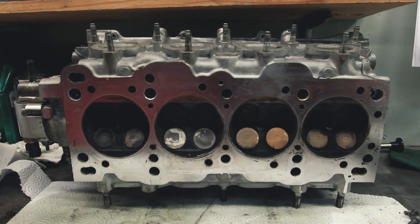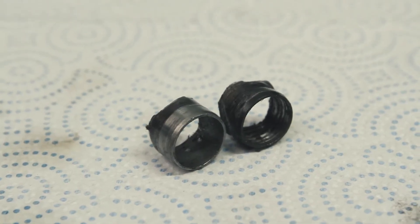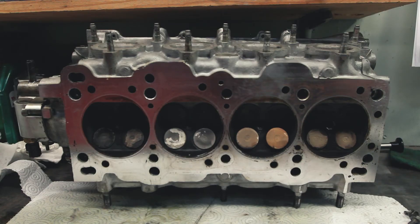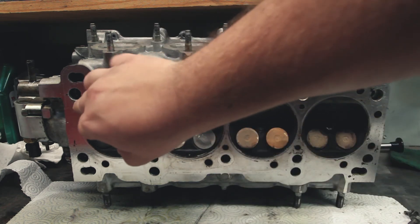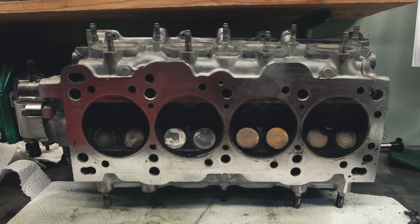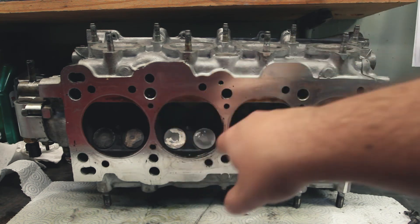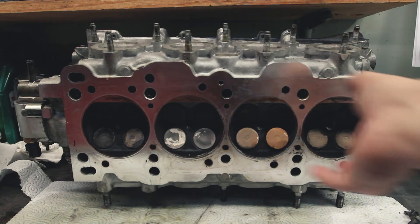These guide dowels fit right here and here, and they help center the head to make sure everything seals and lines up correctly. This one has threads embedded into the side of it, which means someone tried to force a head stud through when it didn't align. The other one shows more how they're supposed to look with a proper oval shape. This damage to the dowel caused damage to the head — the head didn't sit right, which promoted an even worse seal, on top of already having the copper head gasket preventing a proper seal. All these little coolant passages were passing through the different layers of the head gasket into the combustion chamber itself, manifesting into a complete mess of coolant and oil.